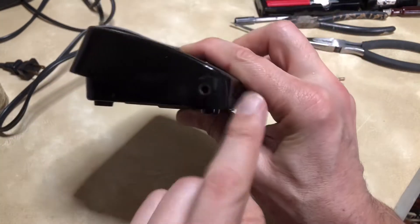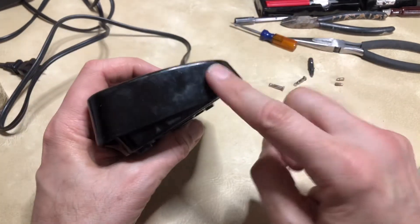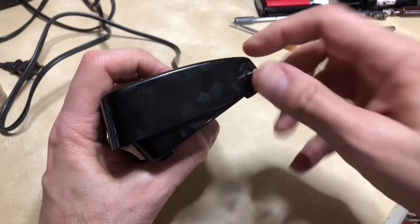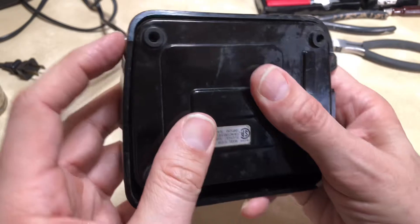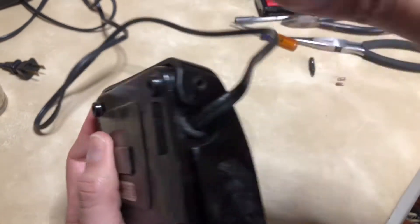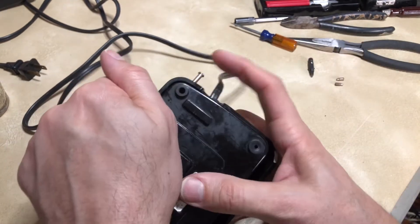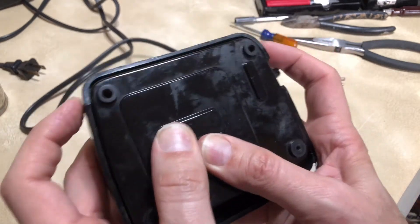The first thing to do is put the hinge pin in. Wiggle it a little bit to make sure it goes in — this side is in. Now come over to the other side. Remember it's spring-loaded, so hold it flat to make sure everything is lined up properly. Push on the pin and wiggle it a bit — there we go. Now both sides are in.